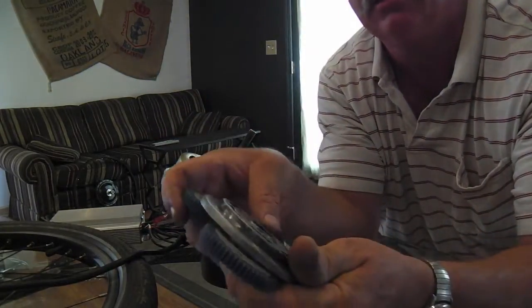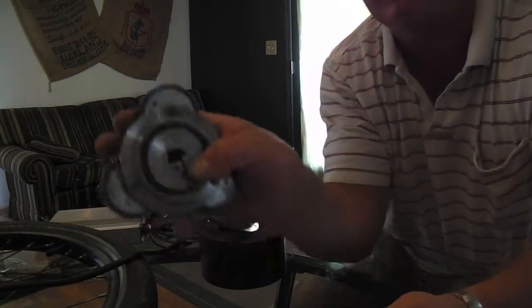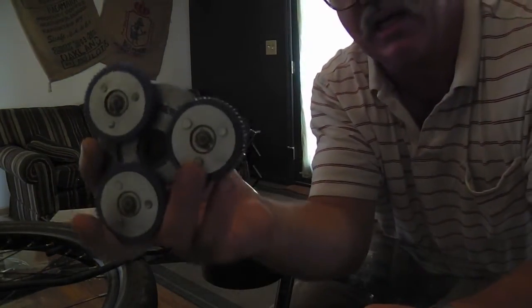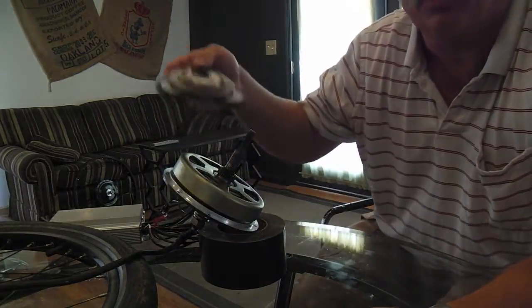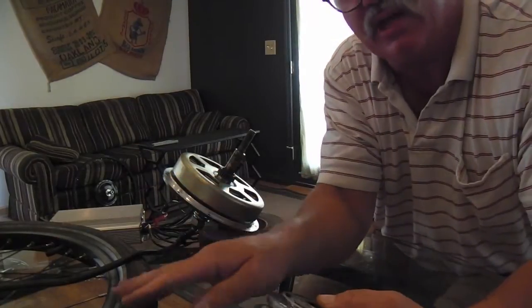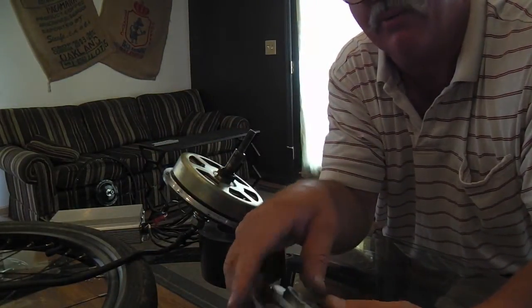And I welded the back where those studs were pressed in and stamped on the back. So now, besides the gears themselves, this is one solid piece. And we're going to put it back in the hub motor, on the wheel, on the trike, and give it a test. And I'm putting it on my existing wheel on the left side, rear.